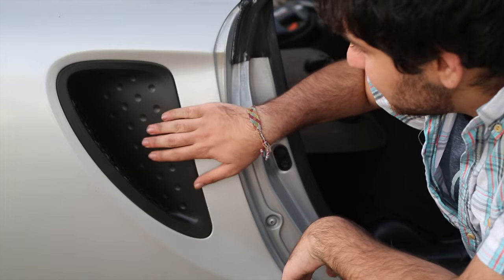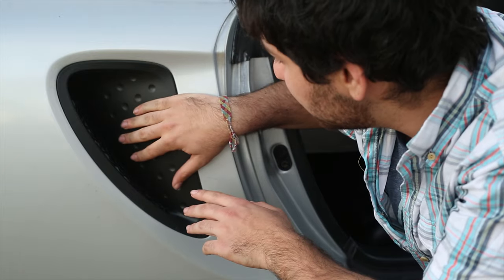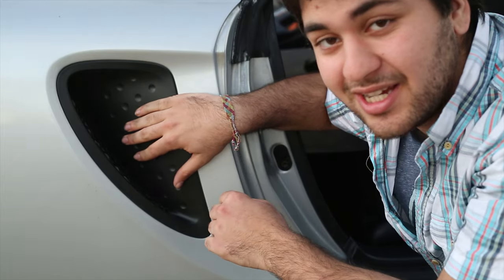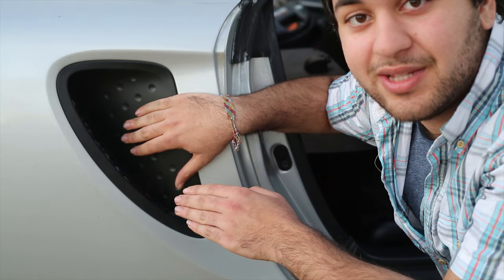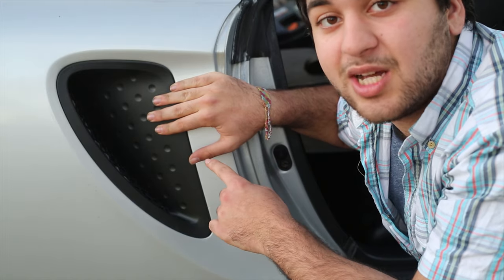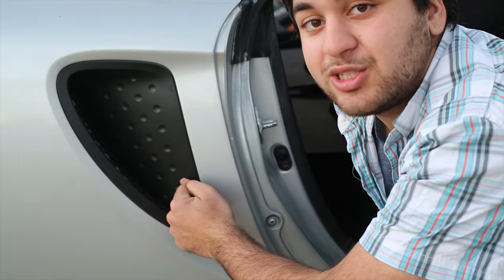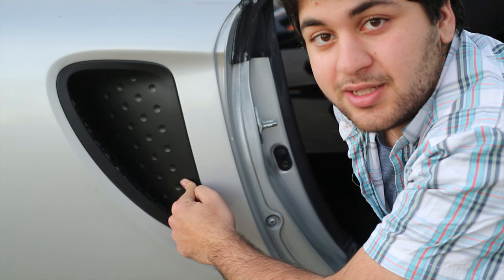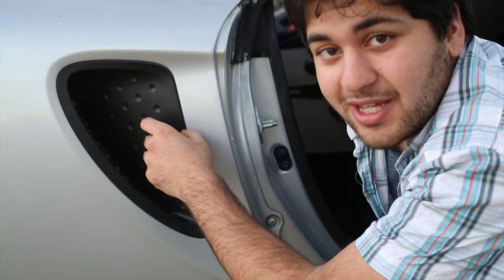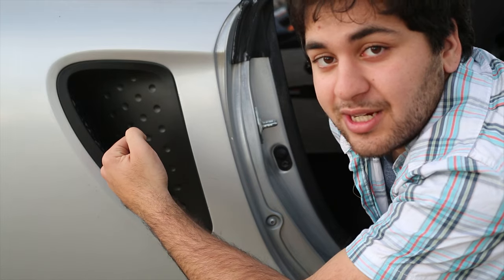Now we've got to take off these side parts so we can get back to the drain inside this compartment. The fact that this is near where the air intake is doesn't mean you're sucking water into your air intake — it's designed not to do that. There are three white clips running down this panel, and you really want to make sure you save those because it's a pain if you don't. Just grip hard and start pulling. You can use a small plastic pry tool, or if you have a screwdriver, cover it in electrical tape so it doesn't scratch your paint, then stick it under on all sides and pull up.